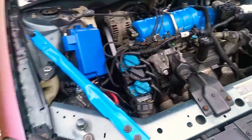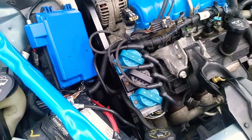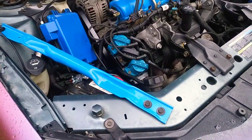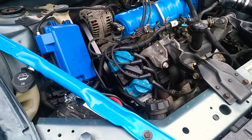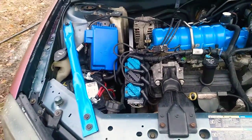See the coil packs — it's been like that for a while. I've changed them; the middle one is a different brand than the other two obviously, but all three of those are brand new. I changed the ignition control module on there — that made her run right.